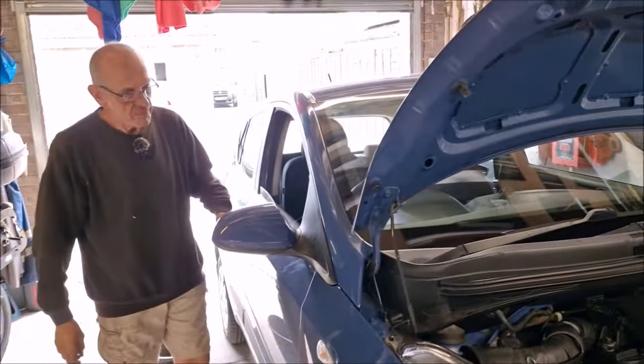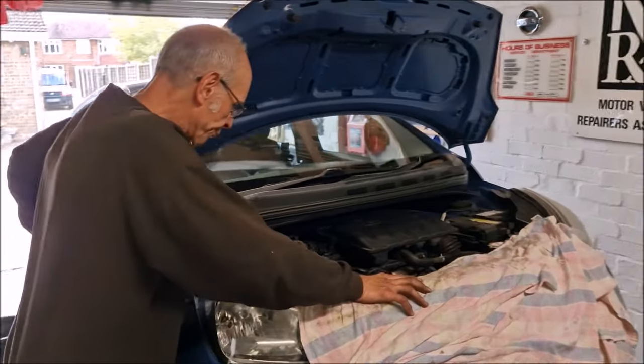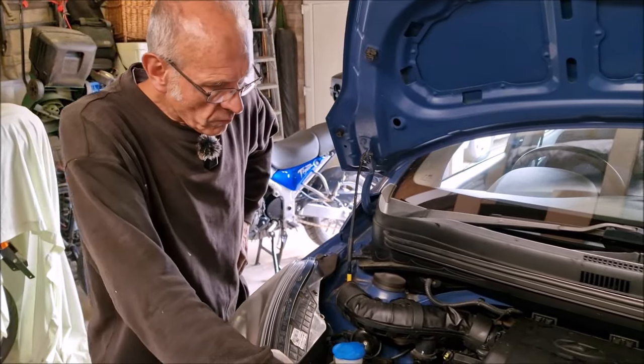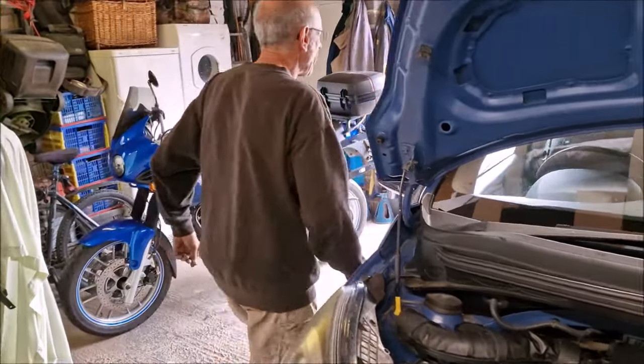It could have been the VVC items. It could have been the VVC solenoid. It could have been, well, no, we diagnosed the belt. But we found out the problem was the timing chain. I've been living with it for 2 years and it's finally got on my nerves.